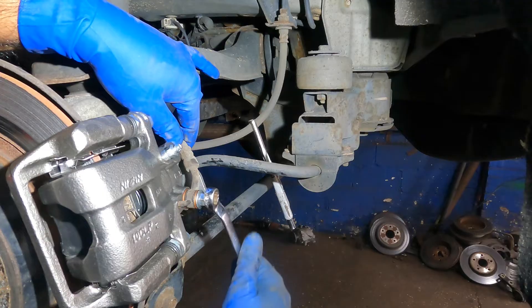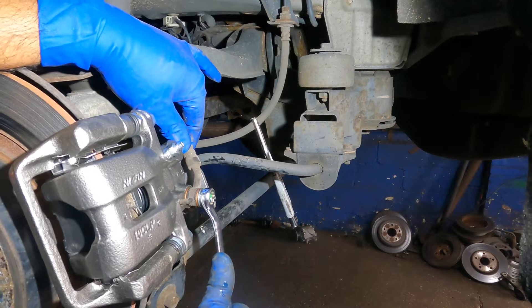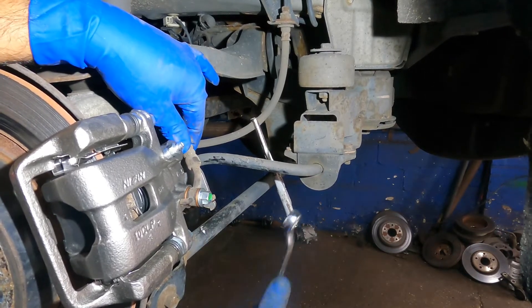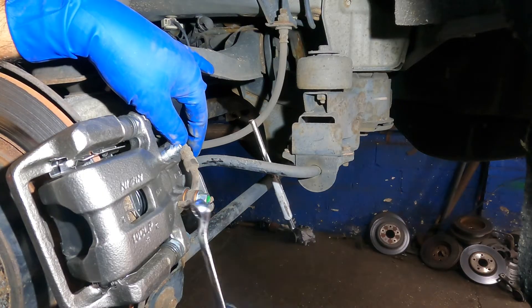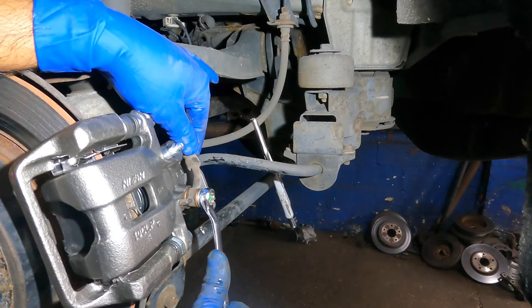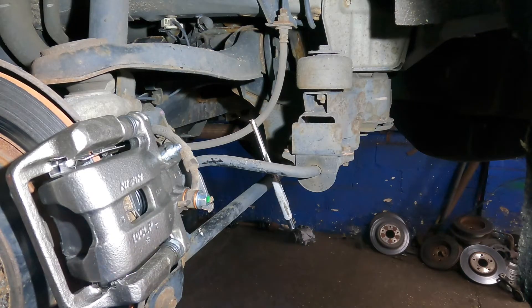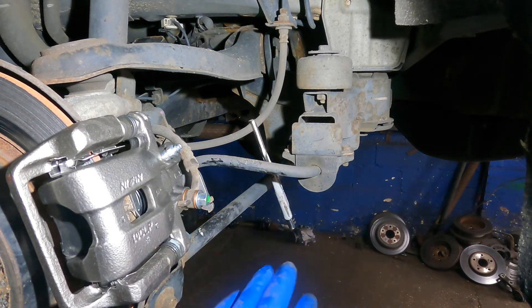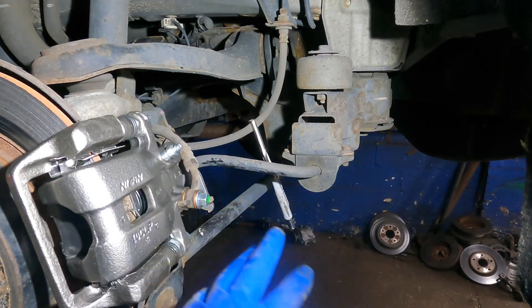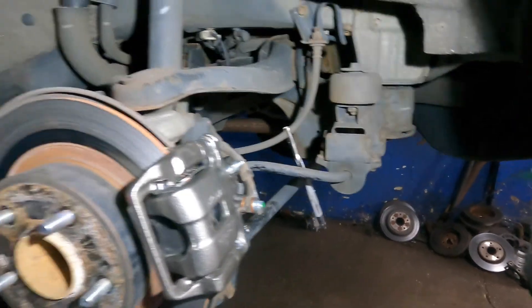Double check all your work — all the bolts. Two bolts on the bracket, two bolts on the caliper, the e-brake cable bolt in the back, and the brake line fitting. Make sure your caliper bleeder valve is up high. It's time to bleed the system — we pre-loosened the bleeder valve so it shouldn't be difficult. Open the reservoir cap and make sure fluid is up to level. Have a helper pump the brake pedal, open the bleeder valve, pump again, then close it. Keep going until the caliper piston compresses and all air is out — the pedal should not feel spongy. Do not send this car out or start it until it's been bled. Thank you for watching — don't forget to subscribe, share, and like.